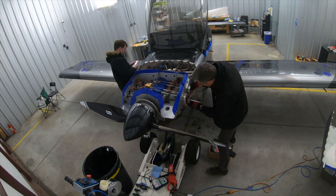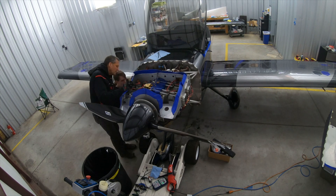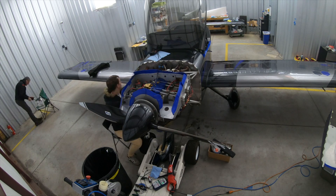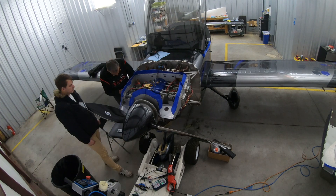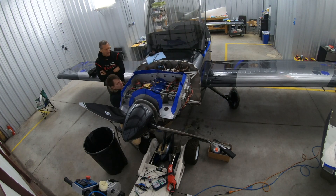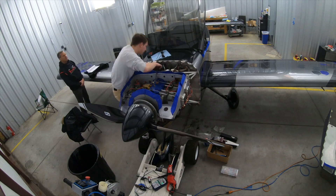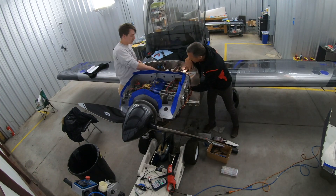The system is installed. You can see on the time lapse coming up, we're just adding a bunch of zip ties to clean up the wiring. It's really important to make sure that there's nothing rattling around in there. As with any aircraft system, it is crucial that you do the system checks at the end. The manual covers them in detail — it's super easy. It just uses a multimeter to check resistance and continuity.